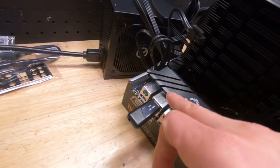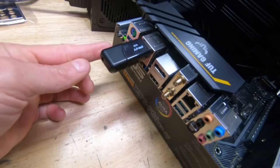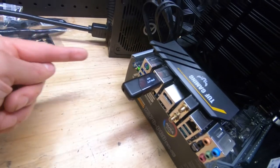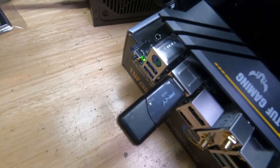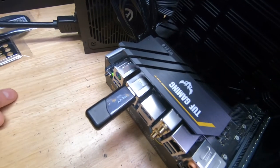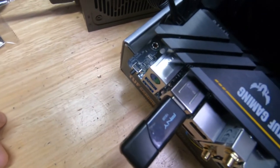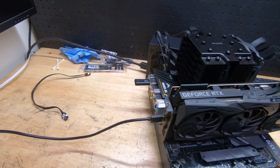You need to put it on a USB flash drive formatted to FAT32. Asus recommends a USB 2.0 thumb drive. Come to the rear IO and put the drive in the top port right next to the PS/2 port. Hold the BIOS flashback button for three seconds. If it flashes five times and goes solid, something is wrong — wrong file, wrong port. Once it starts, you'll see the light blinking. When the light stops blinking, the BIOS has been flashed successfully. Do not turn the computer on during this process — it can take up to eight minutes. Just let it finish.